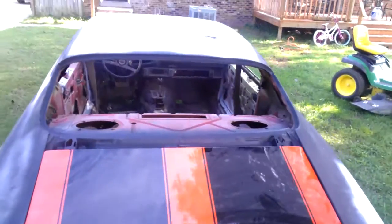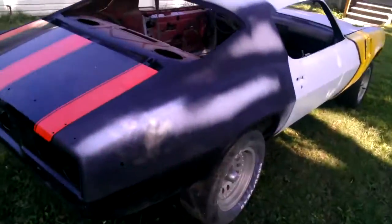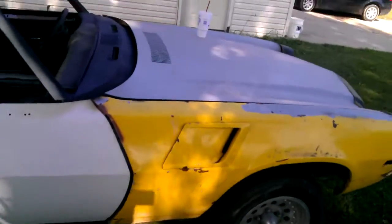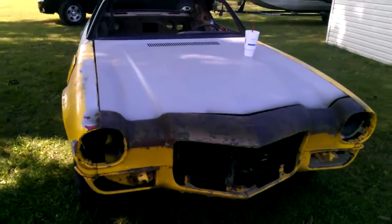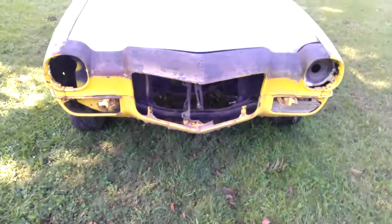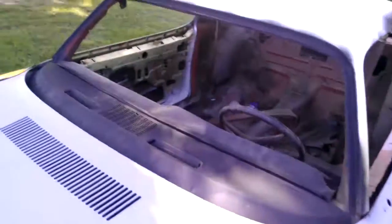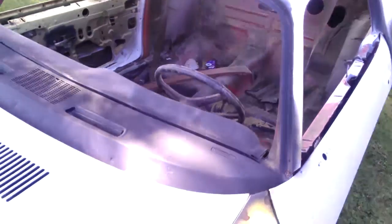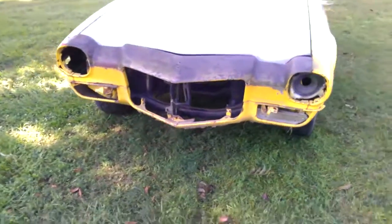I need some money. That's what I need. If I had about $8,000, man, I could really roll on with this thing. Engine, I already got my 400 turbo transmission. We're going with a 6.0 liter. Unless I change my mind, I'm going with a 6.0 liter with a 400 turbo. And I'm gonna put a big carburetor. Not gonna put a throttle body and all that stuff on it. Whatever. We're gonna put a big high rise on it, and when we hit the gas, it's gonna go.